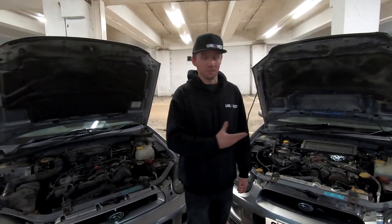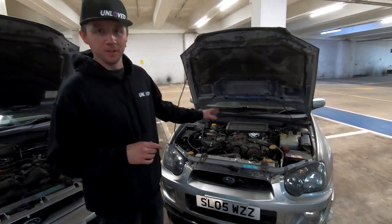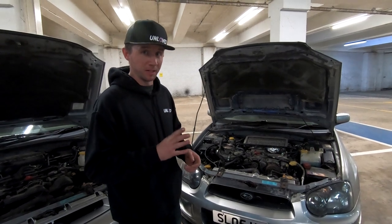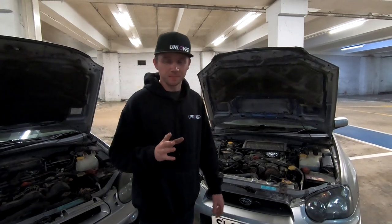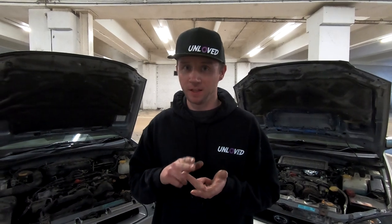This is now basically the same as a Blob Eye WRX but it hasn't come together like that. The engine itself is from a late model classic, like a version 5 or version 6 classic. The intake manifold is from a Blob Eye WRX. The wiring loom for the engine loom, dashboard, ECU, steering column, and everything else is also from a Blob Eye WRX. The differences on the engine are massive. First issue: the crankshaft sensor and pickup on the timing gear is completely different. Same thing on the camshaft pickup and inlet cam — that's completely different as far as the pull is concerned — and then there are issues again with the flywheel and the clutch.